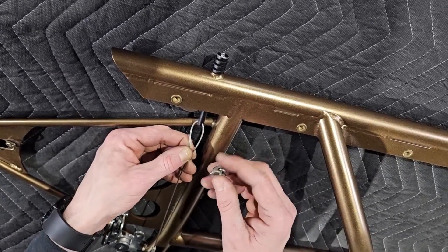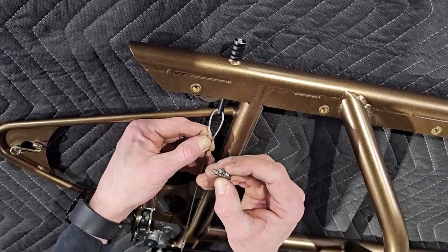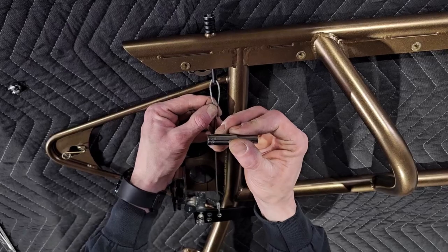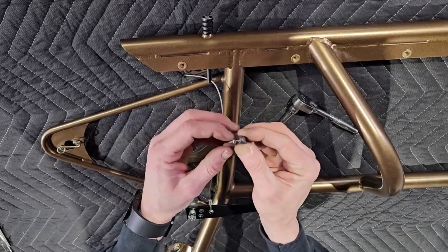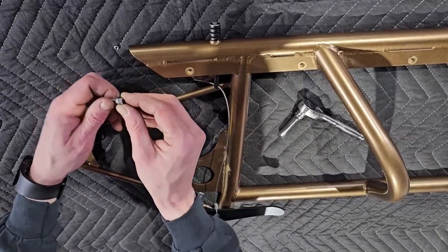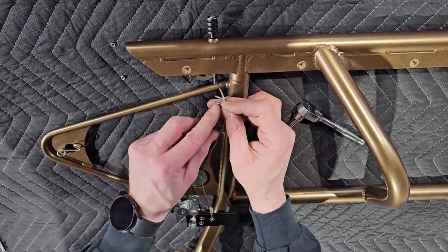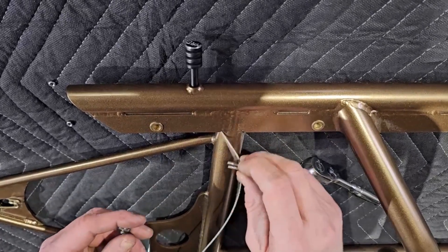When you do that, you're going to unscrew these nuts and just tighten it down. You have a couple of options — this can either be a 5.5mm socket or a 7/32-inch socket when you go for these small nuts. Now, the other thing about these small nuts is when you get it tightened down, you're going to have a lot of extra thread. We normally nip these off and cut them off so that way they don't get hung up on the window flange and window net provisions.